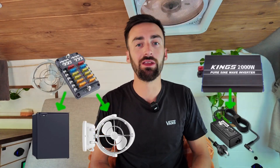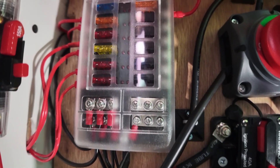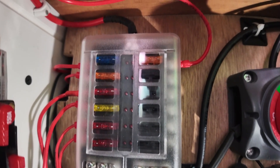Once the power is in the battery we have two options for using it — 12 volt or 240 volt, in other words DC or AC power. On the 12 volt side, power runs from the leisure battery to a 12 volt fuse block, which allows you to plug all of these components in separately to keep things organized, and it also lets you fuse each appliance individually so if anything has a problem, a single line will blow rather than your whole system.